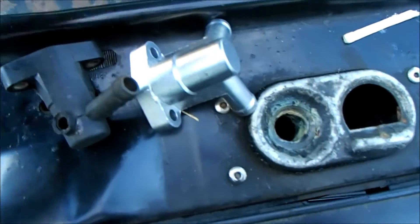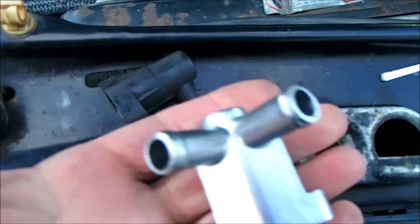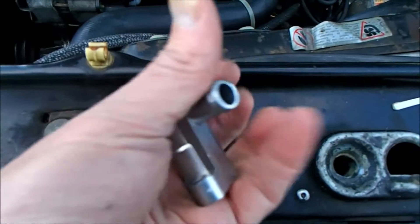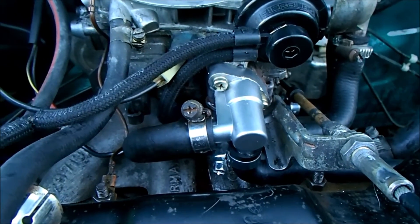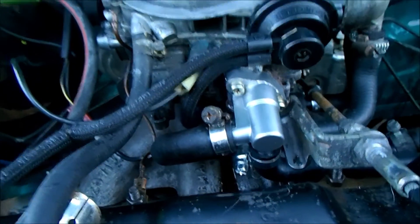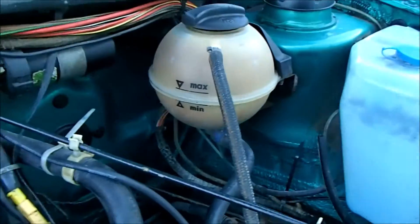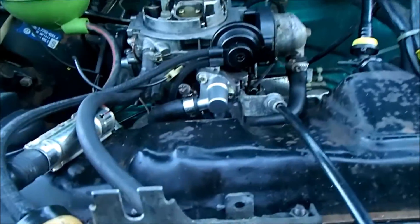Replacement parts have arrived — it's a metal version of the original plastic one. I'm going to get that fitted now. I'm running out of daylight hours so I won't show you the fitting because it's boring and you've seen it all before. The new choke thermostat and new hoses are fitted, which should give a bit more service than the old ones. The carburettor is re-torqued down and I'll just top up the coolant slightly with distilled water.